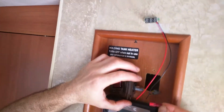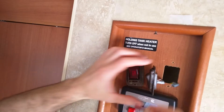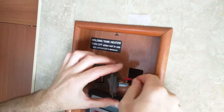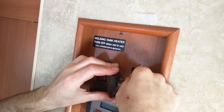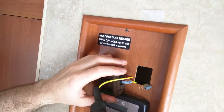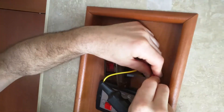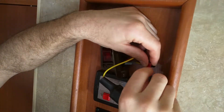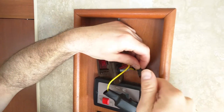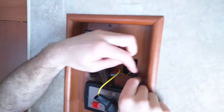To install this circuit there are three points of contact. The female end of the circuit connects to the back of the solenoid switch. The male end of the circuit connects to the wire that goes off to the solenoid. You'll then slide up the shrink wrap that's included — you'll need a heat gun or hair dryer to melt it. If you don't have either, you can just wrap some electrical tape around it instead.